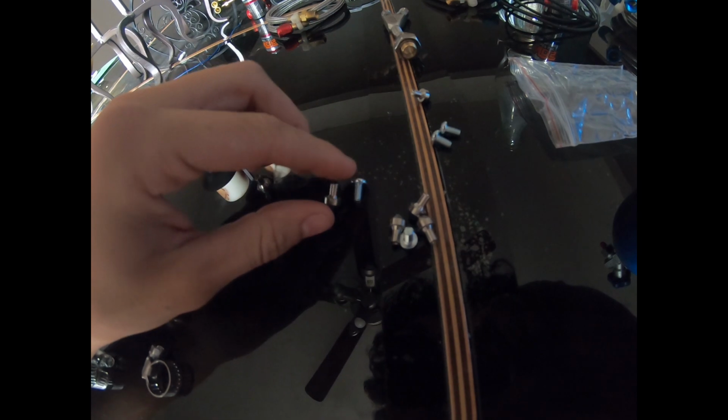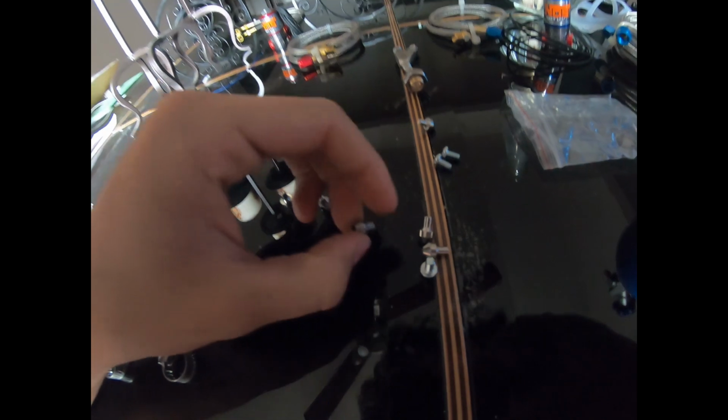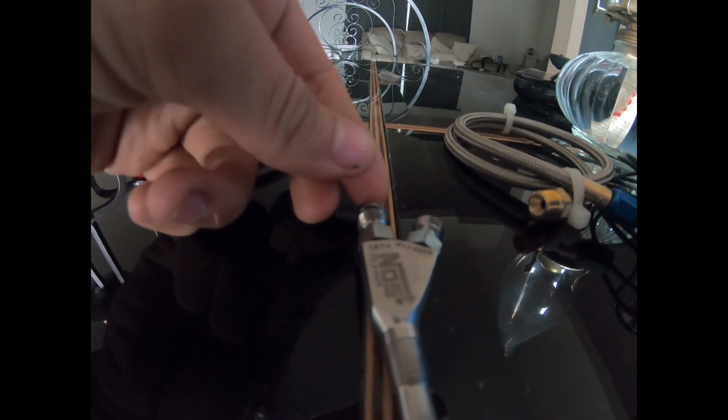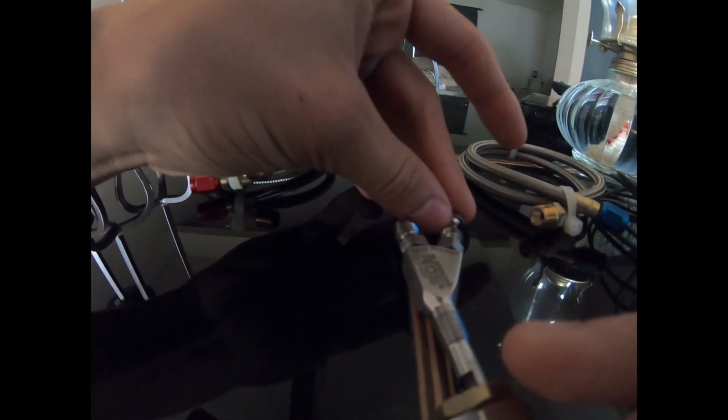And these here are your little jets. These are numbered from, I think, 18 to maybe 36. It might be a little lower, maybe 16 or 14, but I think it's from 18 to 36, and I skip a few numbers in between. They'll give you a whole bunch, but apparently with the number 36 nitrous jet, you need a 24 in the fuel. So this one will go in this spot, and then the 36 nitrous jetting will go into here.